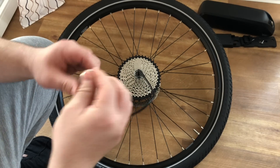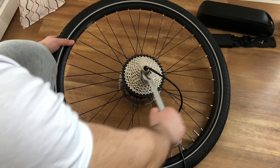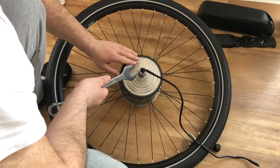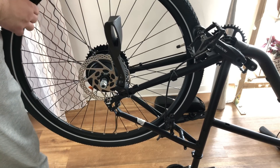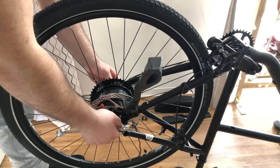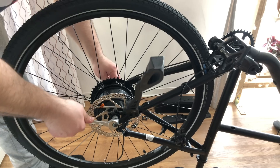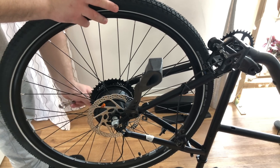There's also a difference in the hubs themselves — you have direct drive and geared hubs. Direct drive hubs are mostly used in motorcycles because they are heavier, and if you don't have power it's much harder to pedal. With a geared hub you can pedal with no issues if you are out of juice. Make sure when you are purchasing your kit that you know what you are getting. I will put links in the description, but in the end it's up to you to read more and educate yourself so you know what you're getting and what you need.